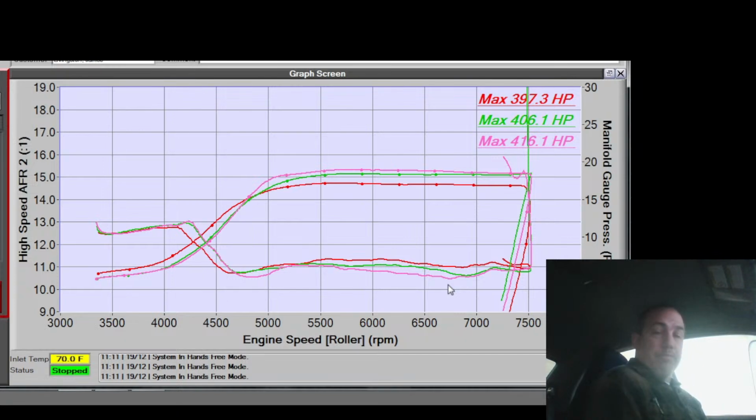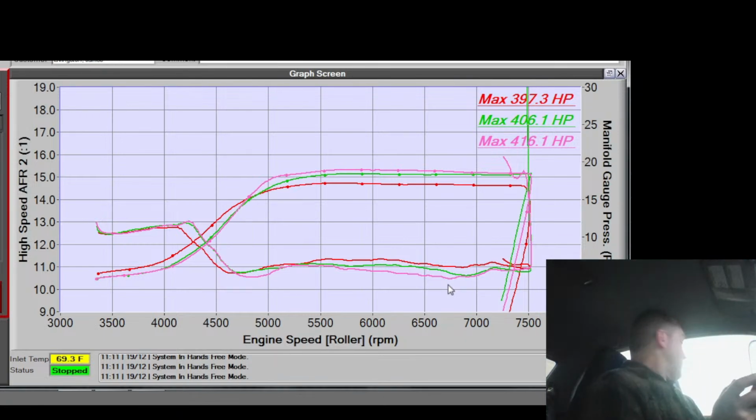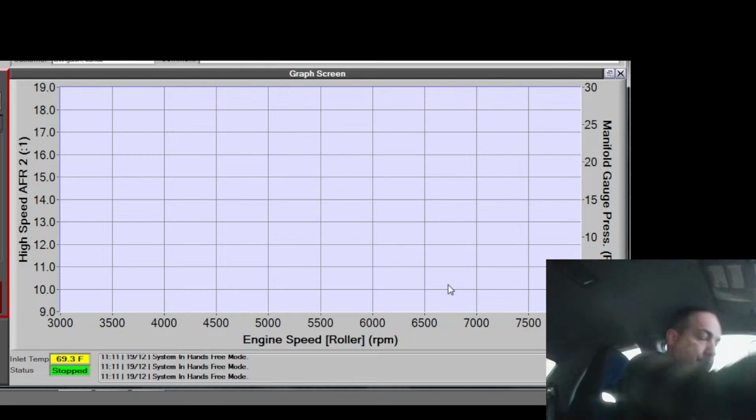It's going to be good. All right, so I think I just do one more pull on pump, and then that's it, because there's no reason to run this thing hard on pump, since he's going to run ethanol a lot. So my goal is to get him to around... Oh, no, I got to check my air fuels up top. That's right, because I changed that. So I got to do a little air fuel adjustment up top.